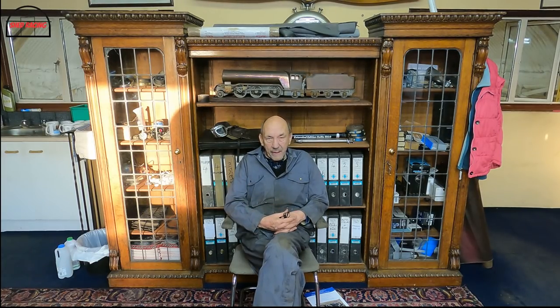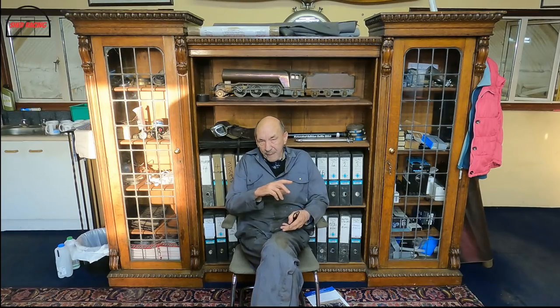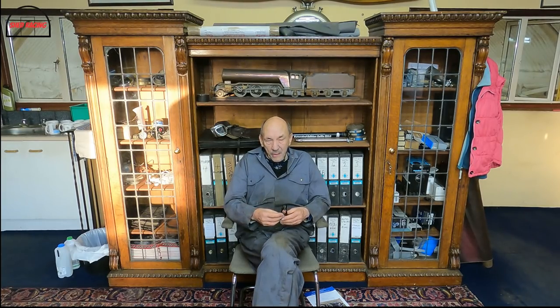They've got a funny system where instead of the spark jumping, it has a little ring that rubs on the inside of the cap. And the minute that gets a bit dirty, it affects it. And I've cleaned them loads of times. So we've now decided that as the caps leak anyway, and the spark jumps across to the various bits and pieces, I'd sort through all the old junk. So I've got a box of distributor caps. We got them out, and we found the only one that looked like we could modify was off a Ford, which is lovely. So we've had one, and we just ordered another one.